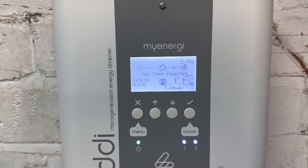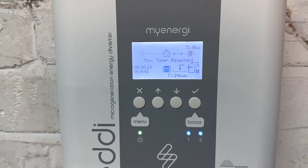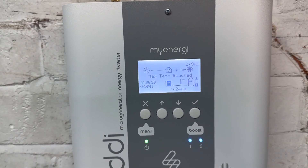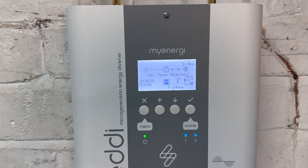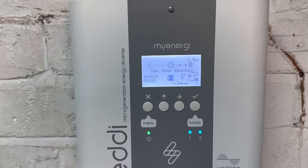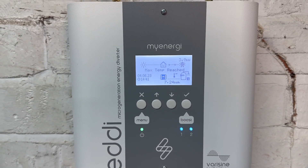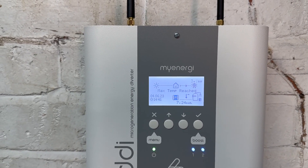You can see now that it's had the desired effect — the temp has cut off after putting in 7.24 kilowatt hours, the tank is full. I just checked the Mixergy app and the temperature is around 69 degrees, so it wasn't far off. I'll tweak that a little bit more to see if I can get closer to 65. But pleased with that — it's obviously a lot better. 70 is still a bit high, but it's a lot better than 80 or 85.